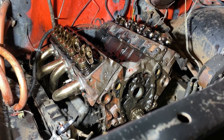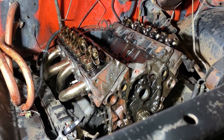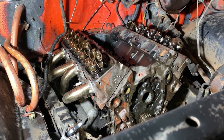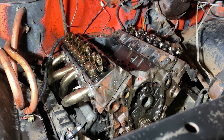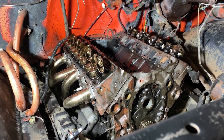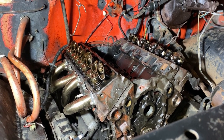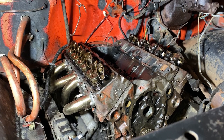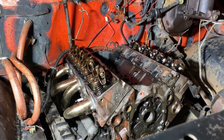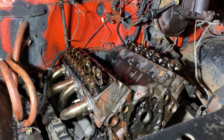I really didn't want to pull this motor, but thinking about it with that cam bearing being bad, I'm just going to take the time to take the headers and spark plugs out, pull the oil pressure line, take the six bell housing bolts and the three torque converter bolts out, and just pull the motor out. It's going to be that much more simple to pull the motor out, replace the cam bearings, then I can clean up the motor and paint it all nice.